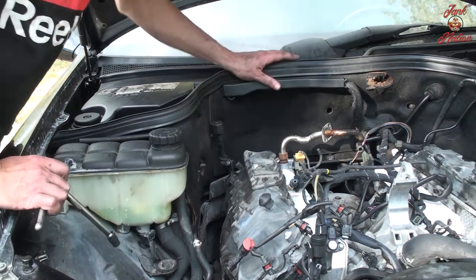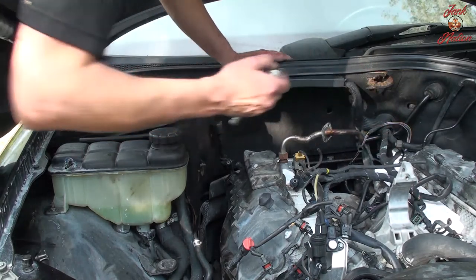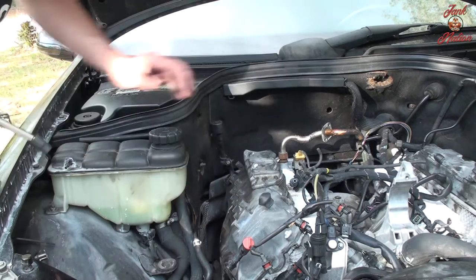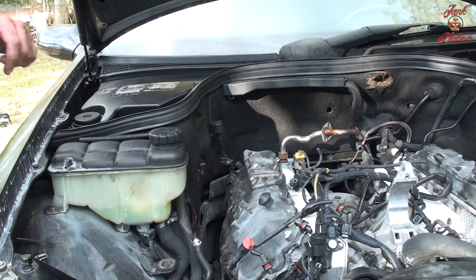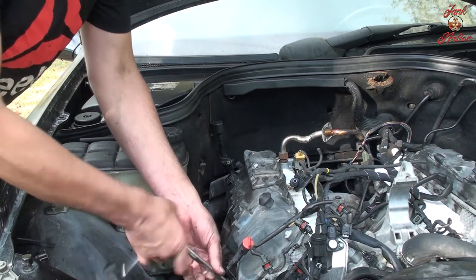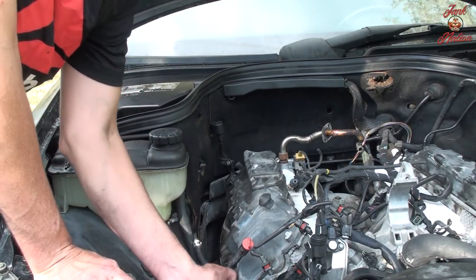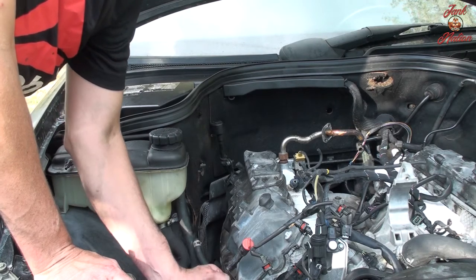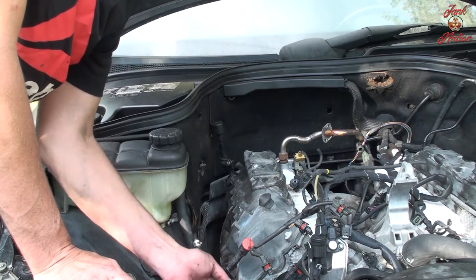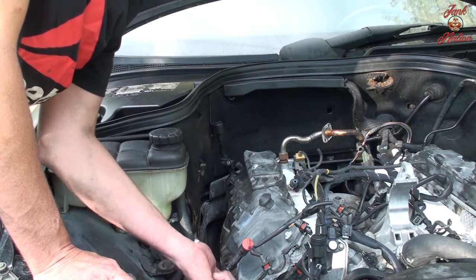Alright, so just to make sure, I definitely know that whole valve cover over there, driver's side, needs to be replaced, which is a shocker for me. I thought I was just going to seal them up and put them back together today. Now tomorrow I'm going to have to plan a trip to the junkyard and hopefully find a car that has this motor in it and pull off the valve covers. While I'm at it, I'm going to snag another ignition coil with the wires, because that one ignition coil had that corroded connection, which was never plugged in correctly, I guess, from whoever.